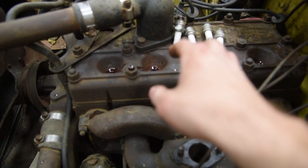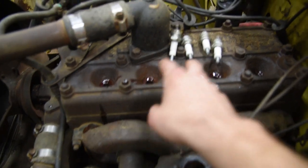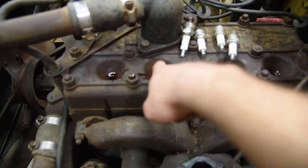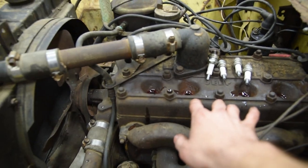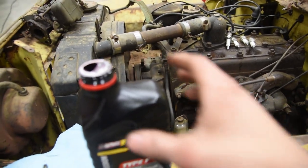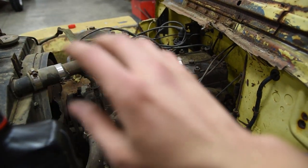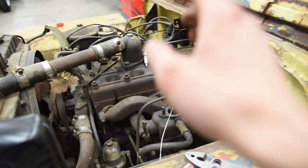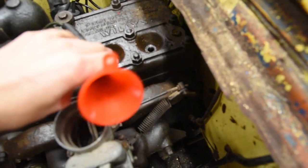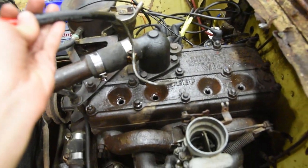The problem with the flat is if you have a borescope, you can't really get to the cylinder because straight down in the plug are the valves and the pistons are actually, you know, back here relative to the spark plug. So it's hard to get one down and then to look inside there. So this is just precautionary. It does turn over, but we just want to be safe. Now, because we poured ATF down the cylinders, when this thing fires up, it is going to smoke like a banshee because ATF is flammable. You need a contraption like this to go in there and to aim down into the cylinders. So that's why that's like that.